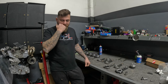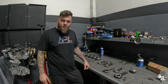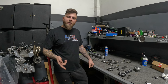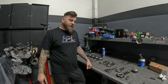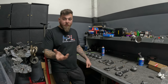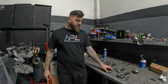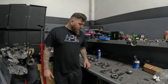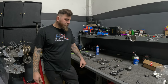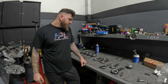We just recently had one of our customers, Chris, put an order in. He's getting a 2.2 SLR — a semi long rod motor — and initially he paid for aluminum rods. But then he called me and said, look, it's a street motor, what do you recommend? I said: if it's an actual street motor and you're making under 900–1000 horsepower — he wants 850 — you should stick to the Cali's 153s. Just don't jump the gun because aluminum looks cooler. It won't make more power; it'll take more power, but it also becomes your service point.